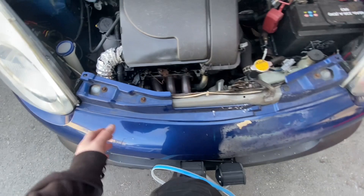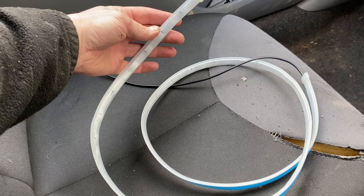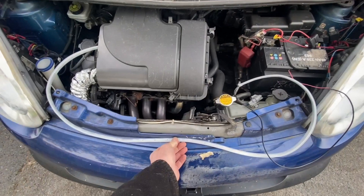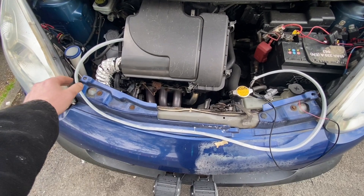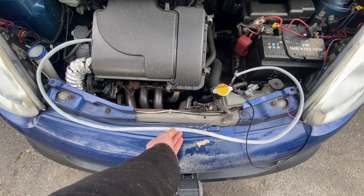I was hoping for that but it's too long. I'm hoping that like a lot of these LED strip lights I can just cut the end off, but if I demonstrate how it works you'll see why I can't do that. As you can see during the startup procedure the lights sort of cross in the middle, so if I cut the end off it still works — but what I'm going to have to do is put the middle point in the center of the vehicle.